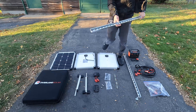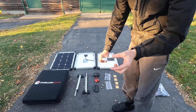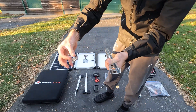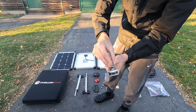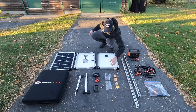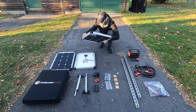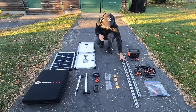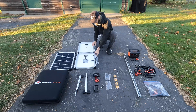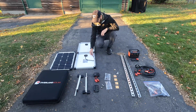These extend so you can angle the panel, but I didn't need any of that — I wanted to reduce as much weight as I could. This is a half channel; a full one is here, half is here. With the size of my box I needed as much clearance as I could, so I went for the smaller one. These mount on the sides of the panel. One reason I completely disassembled the panel is because I'm not doing this orientation — I'm doing this orientation. These struts will be mounted to my roof rack and attached along the sides with spring nuts.